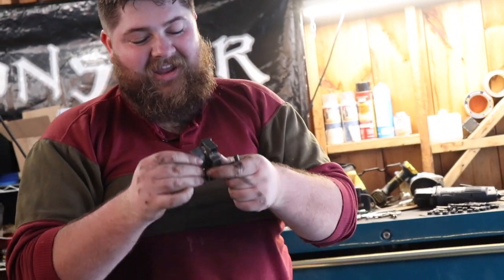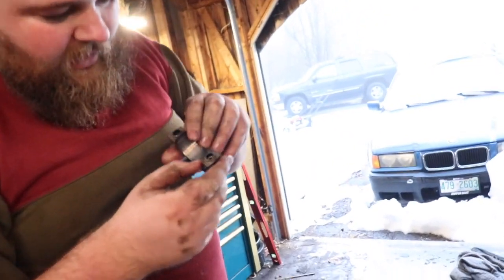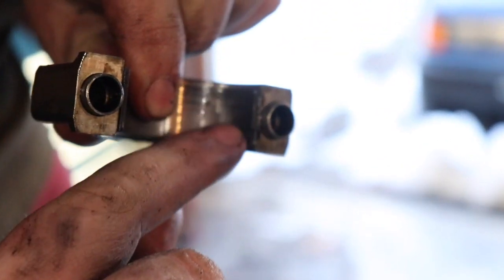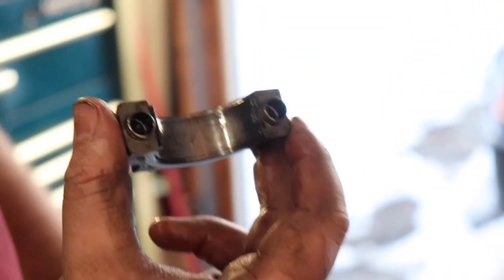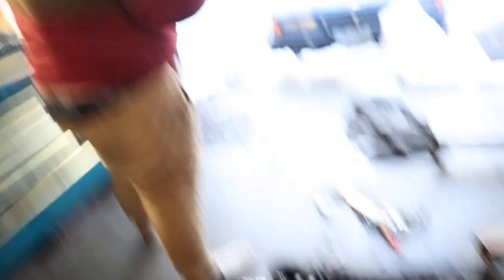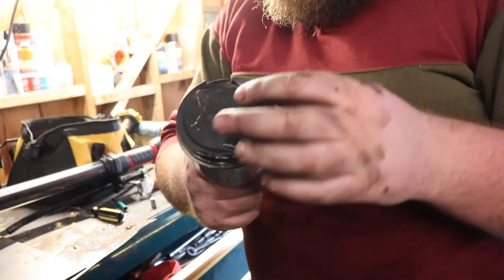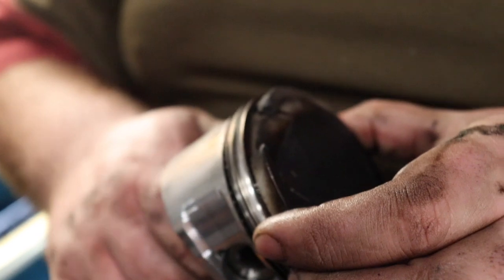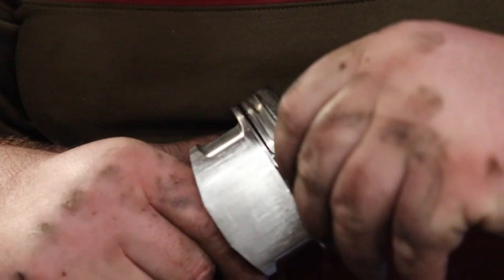That one looks clean — and the bearing shell was still on the crank, fused to it. You can see the traces of the coating up there, that dark gray substance — and then just rough and gritty down here. That's bad. I'm going to pull the last piston out; this is the worst one, at least from the top I could see. Yeah, she got melty. Under there — that's like almost two or three millimeters of ring gap. It's like the top of the piston wanted to come off. Yeah, compression had to be deadly low. It was low.